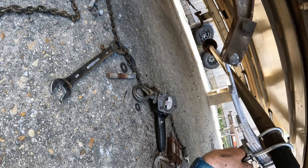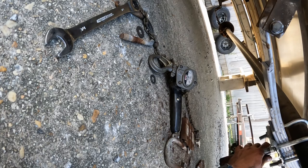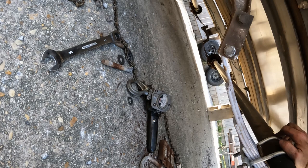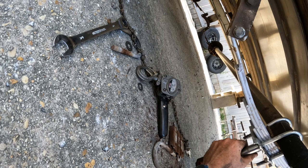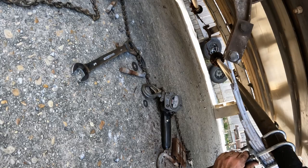You don't want to just put your impact on one of these nuts and run it down. This is something you want to work evenly — you want even threads, you want everything even. Watch it while you tighten it, get everything even.